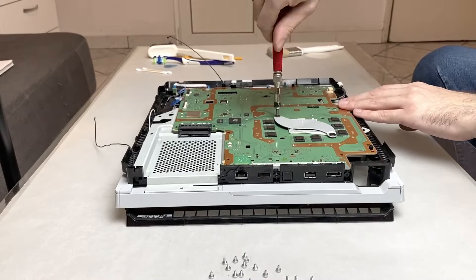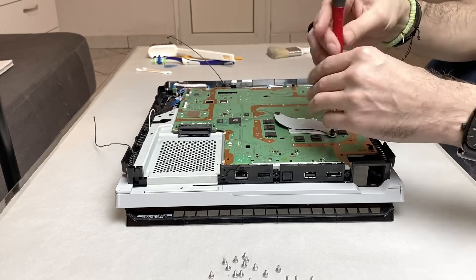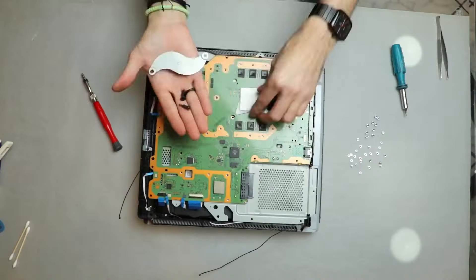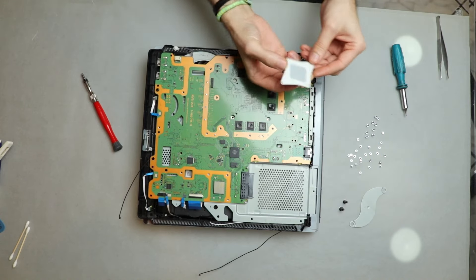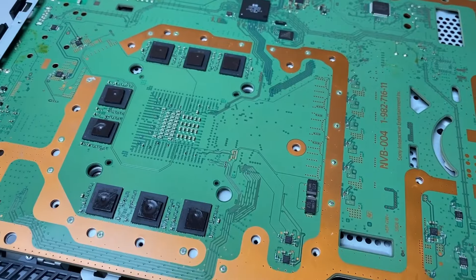Now I remove the pressure plate by gradually unscrewing those two screws. There are two plates here — I also keep them grouped alongside the two screws to keep track. There are eight chips here with thermal pads placed on them. The thermal pads are not stuck there and they might come off, so be sure not to lose them.